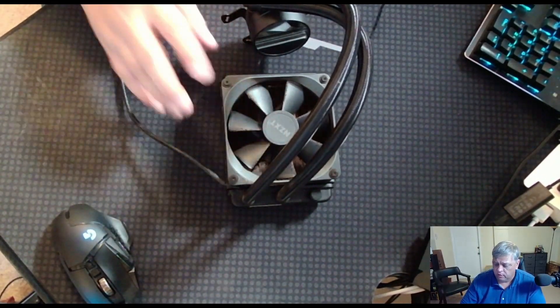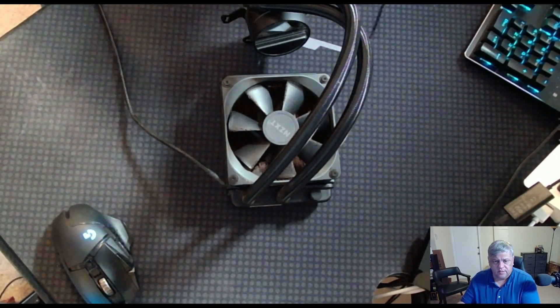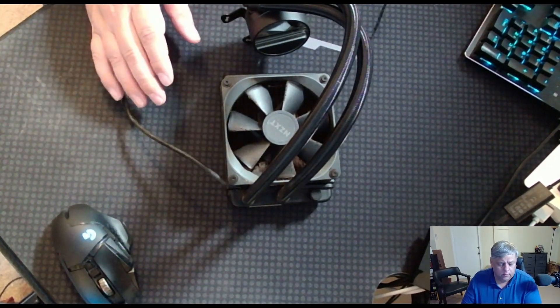I know I need to take this fan off. The fan needs cleaning up and I can already see some dust and everything that's collected on the radiator itself. So we're going to go ahead and try to clean that up as well. I'll probably have to take it in the other room — I've got a shop vac in there — and just get out as much as I can, then try to use some alcohol wipes and isopropyl to clean up the fan and everything. Then see if once I get it clean, I can put it on a system and see if it can hold an idle.